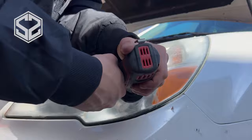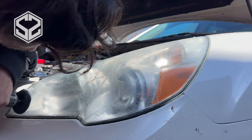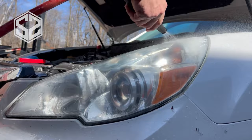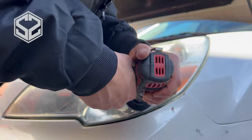I'm going to do pretty much the same thing — sand over everything really well twice and rinse this off in between, and then go up to the next 3000 grit sandpaper. You can tell a lot less is coming off of the headlight with this finer sandpaper, and the particles are a lot more white or clear. That's a good sign — it means I got all the yellowing and fadedness off with that first round of sandpaper.